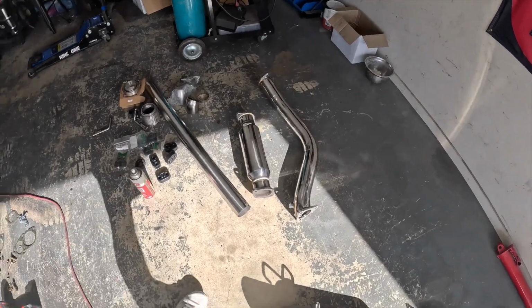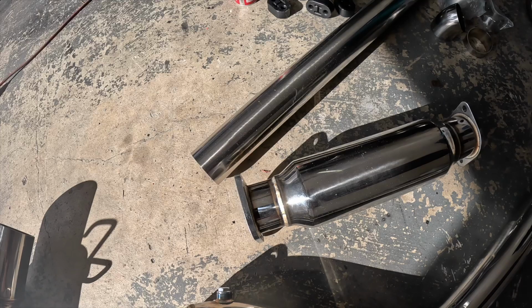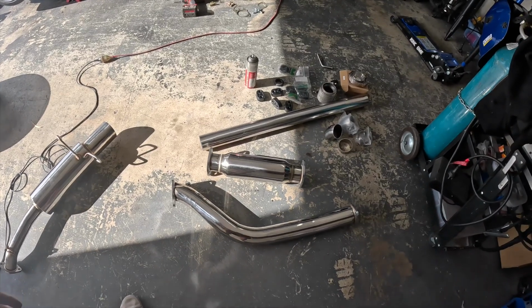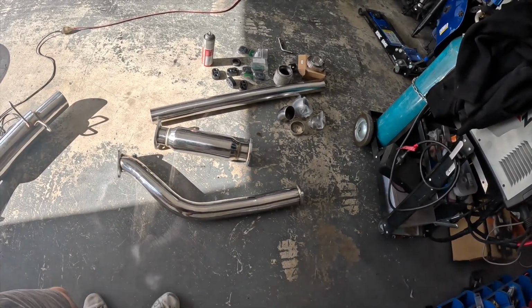and I can work out the front pipe. Before I put this on, I'm going to whip one of the flanges off, as I'll end up chucking the V-band on it, as that's how it'll go later on. There's no point putting a 2-bolt flange on for now. Yeah, it's just easier. V-band's so much quicker to take off as well. Don't have to worry about that pesky gasket.